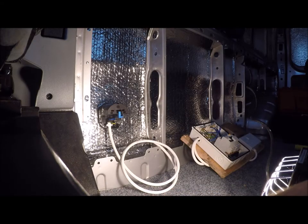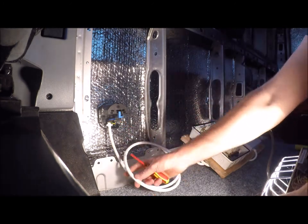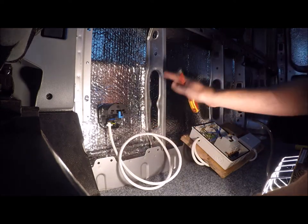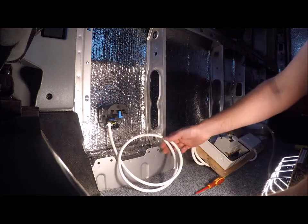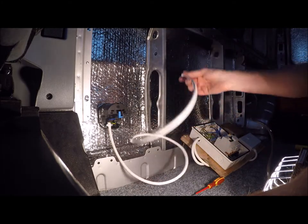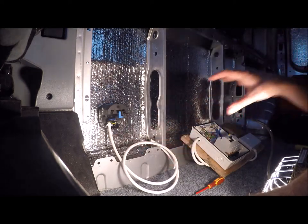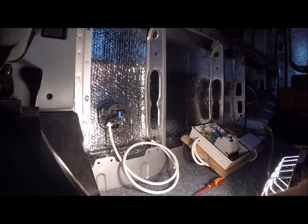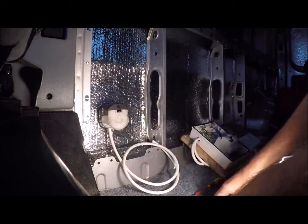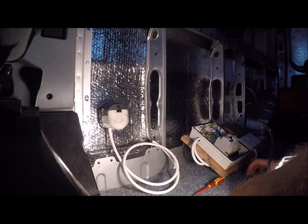As you can see here I've wired it up. It's this flexi three-core stuff which is good for a camper van because obviously it creaks and shakes and twists with the momentum of driving. I've cut off just over a meter. It's coiled up for the time being because I'm not going to connect it until the fuse box is in place inside the cupboard. I'm going to put the cover back on and then put some insulation in and boards on, and we'll come back to this at a later date.